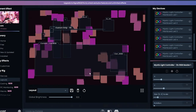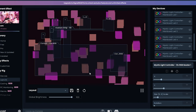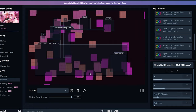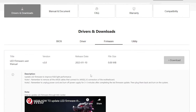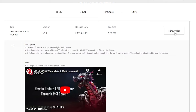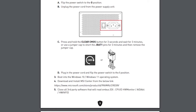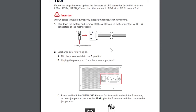SignalRGB and OpenRGB do detect MSI motherboards — I would assume any MSI board with RGB components will work with SignalRGB, though I can't guarantee every single board. Also worth noting: on the firmware update section for the B550 Gaming Plus, there was an LED firmware update. In true MSI fashion, it was not clear what it was for, and the documentation went out of its way to say don't update this if everything is working properly. It required shutting down, disconnecting everything, and turning off the switch. Since everything was working fine, I chose not to do it and I wouldn't recommend doing it either.